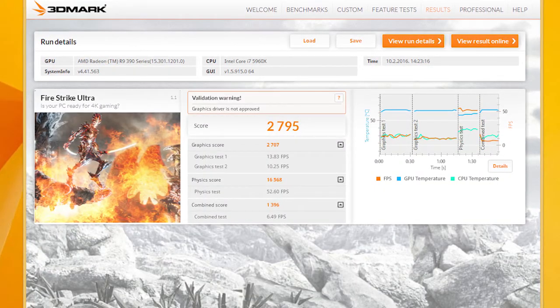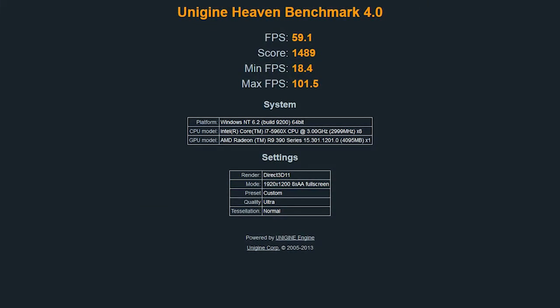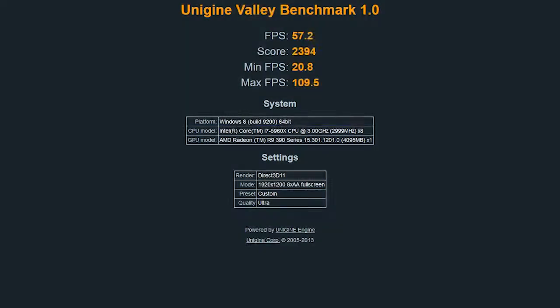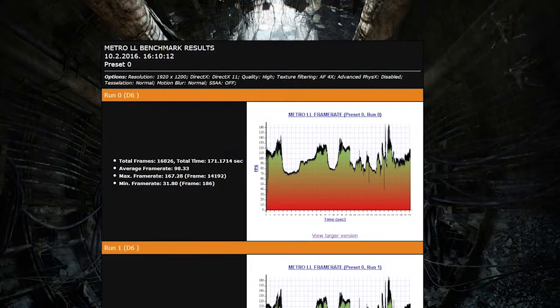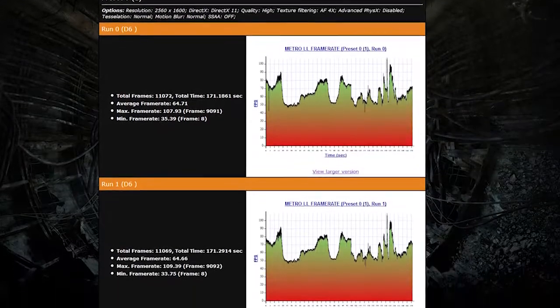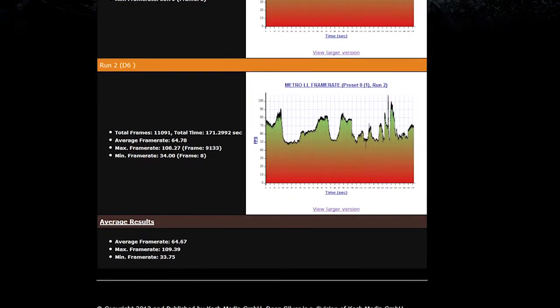Some of them have a bit lower, some of them a bit higher core clock, and based on that you can pretty much accurately estimate the performance difference, give or take a few frames. That's not a big concern, as even if you have a R9 390 model that has a bit lower GPU clock speed, you can always easily overclock it additionally to make up for the difference. Bottom line, when the performance difference is not that big between an X example and Y example of a brand of R9 390 series, the only thing left to compare is the coolers themselves, and that's what I tend to look at in such cases.